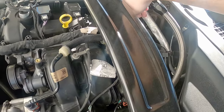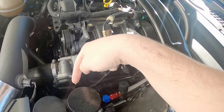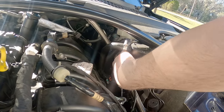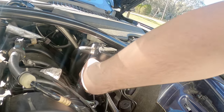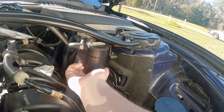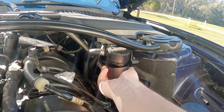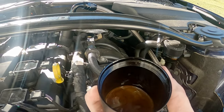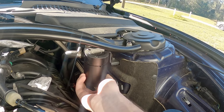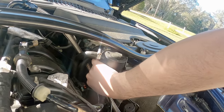So I know this is working the way I intended it to. I'm assuming I'm going to check the tank too — it should have oil accumulated in it. But first I want to check the Mishimoto catch can and see how it's looking. I emptied this out when I installed all the new ones because I wanted to see how much accumulation happened in each one. That's caught a fair bit of nastiness as usual — that's why I run these things, because this new combo creates a lot more oil vapor than the last engine did.